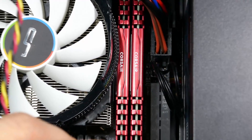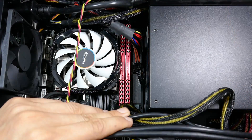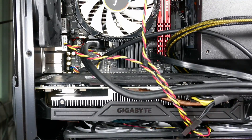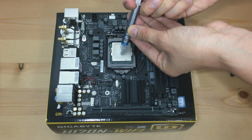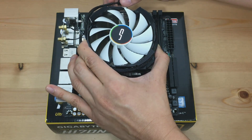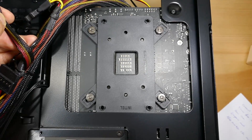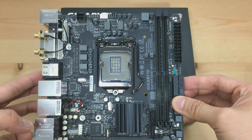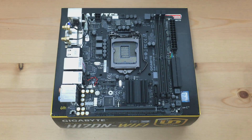Lastly, this might not be a drawback, but I'd highly suggest going with the most RAM you can afford, because Mini-ITX motherboards by nature only have two RAM slots. Also, you cannot crossfire or SLI because there is only one PCI slot. For those interested in installing an aftermarket CPU cooler on this motherboard, I'll put a link in the description below. That's the end of this video — I hope you found it useful. If you did, please press the like and subscribe button. Post any questions in the comments below, and I hope to see you in my other videos. Thanks and bye!